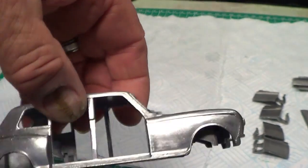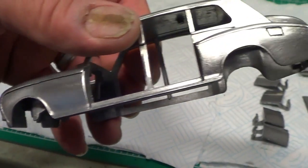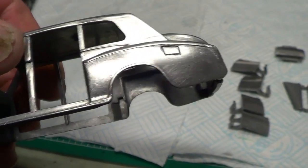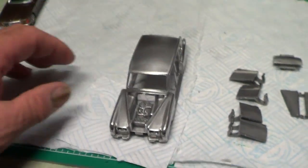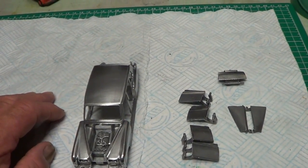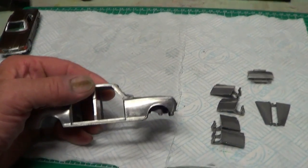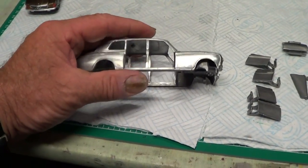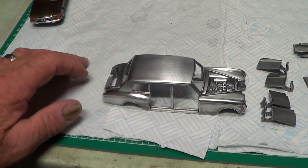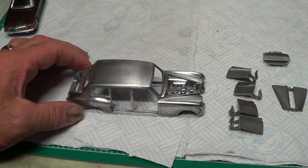Now, I don't know whether this is because it was a kit one or what, but anyway, like I say, it's still not 100%, there's still some pitting there, but it's a lot better than it was. So I'm going to give it a good clean now with methylated spirits and then leave it to dry off, and tomorrow when I come back from work, I'll start to spray it. I'm going to do it in metallic colours, two-tone. I won't put a primer on, but I'll spray a metallic coat on it as an undercoat. And we'll see how it goes.